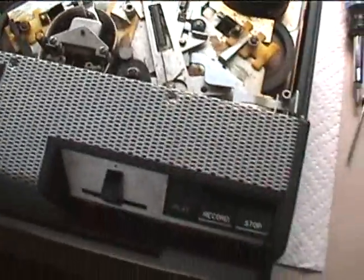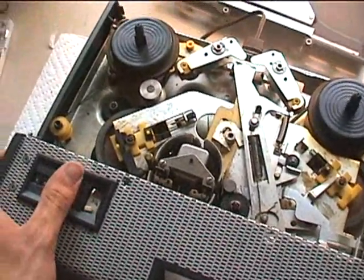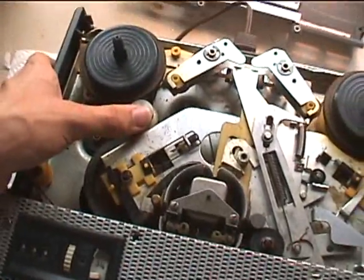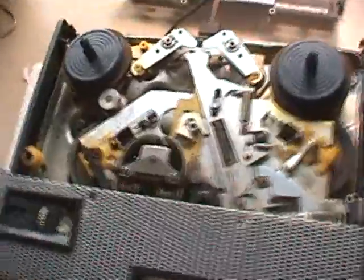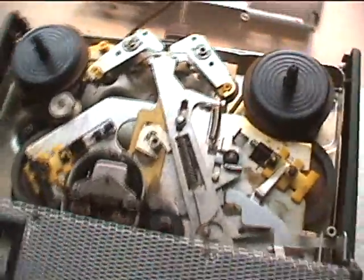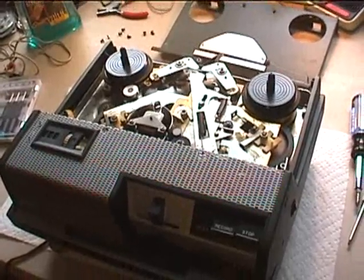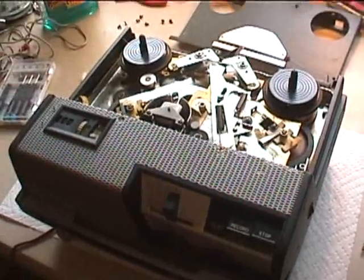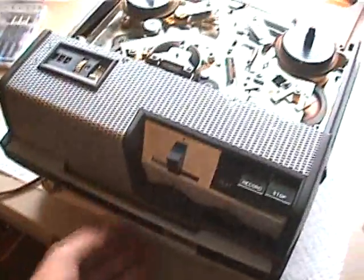This machine is working very nicely. I'm just worried that I might have to replace the motor run capacitor one day, because the motor, when it runs for a while, tends to get real hot. On an AC motor that runs with a capacitor, if the motor gets extremely hot in a matter of a few minutes, that usually — if not always — means the motor run capacitor is failing. That's just me learning from experience. It's a very nice machine.